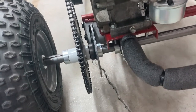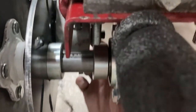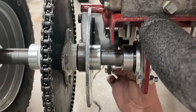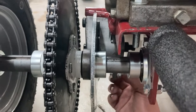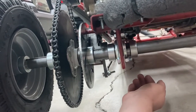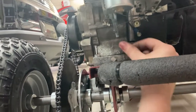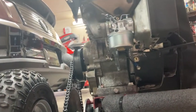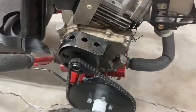This thing stops very well. It's an easy adjustment on the back side - I can kind of show you right here where my finger is. That right there is the adjustment to control how much clamping you get when you use the lever. Got it all adjusted, took it out for a little spin, and when you get to full throttle it starts acting up for some reason. It probably needs a new spark plug for sure since I haven't changed the spark plug in this thing in I couldn't tell you how long.